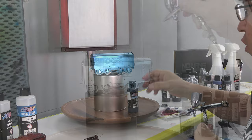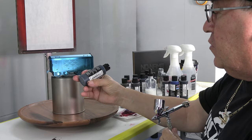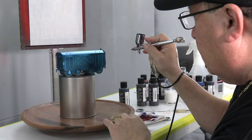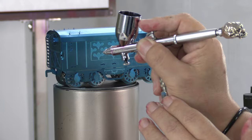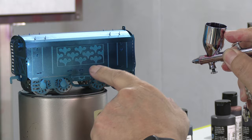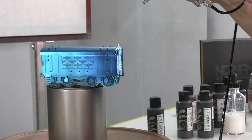We're going to enhance the intensity of the blue color here by adding Candy 2.0 midnight blue — it's a very strong color — and I will blend it from the end of the wagon to the left, slowly making it a little darker in this area. I always spray from the end to the center, because if I go the other direction I double-mark. So I need to be careful and blend it progressively so the intensity of the color comes from the end toward the inside of the wagon.